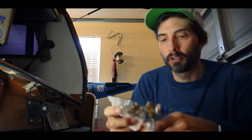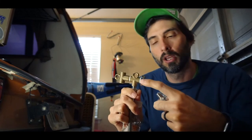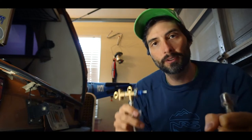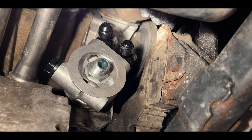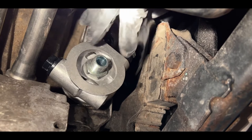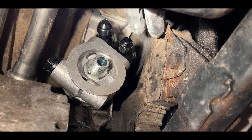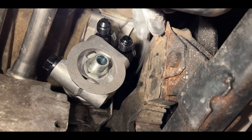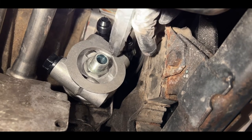The last part of the install is going to be the relocation of this, which is the low pressure sensor that usually goes between the push rods near cylinder three and four. Everything was torqued to spec, everything was ready — and then as I tried to fit the filter on the adapter, because of the angle that these two fittings are at, the nut that holds the hose into this fitting hits the filter.